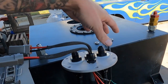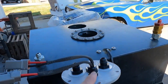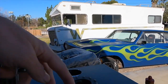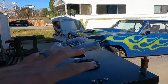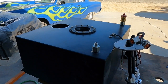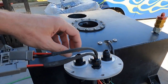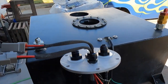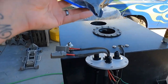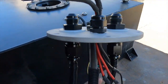For the Twinnebago build, I'm going to change back to the original tank and set one of these up there too — I need both a feed and return on that one. For this eBay fuel cell setup, I could probably eliminate one line and just have a single feed, but we'll run dual lines and use a Y-fitting. So we'll run dual dash-8 lines into the Y and then run that into the filter and the existing line. That's how we're doing it.